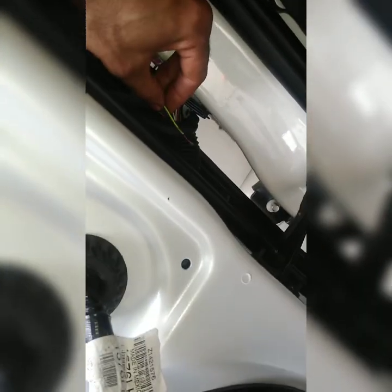I'm going to strip it right there, put in brand new wiring, slip in new stuff and get it done. But yeah, that's another brief test you can do — just pull out this green/yellow wire, and if it pulls out, you've got a broken wire.